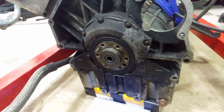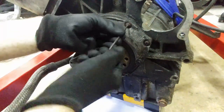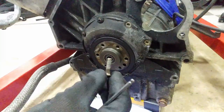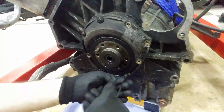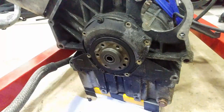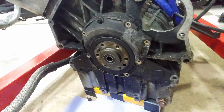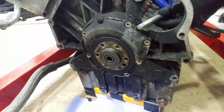Being an oil seal I have no idea if it's going to have a little leak once the case is loose. The sump is drained but I'm sick of mopping up car juice, so I took precautions and got my gloves back on. I left the top bolt in, very loose, just in case the cover flew off — it's just a little habit of mine. There's a pair of small tangs and a cutout where the starter motor goes, and it was perfect to gently tap on to break the gasket seal using an aluminium punch and a few light taps.